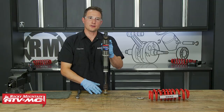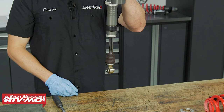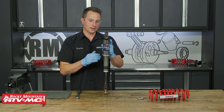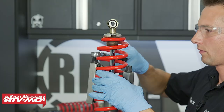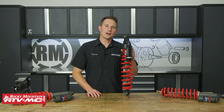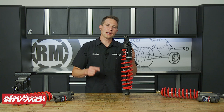Once the shock is filled with nitrogen, compress it all the way down and let the shaft extend all the way on its own. If you see any dropouts or it doesn't extend fully on its own, something is wrong and you need to go back in and figure out what it is. Now reinstall the shock spring and reset your adjusters. That's everything you need to know to get your Fox shock rebuilt on your Polaris side-by-side. The rebuild kit is available under the OEM diagrams on our website. Don't forget to subscribe to our channel. I'm Charles with Rocky Mountain — thanks for watching.